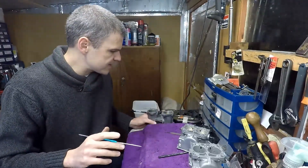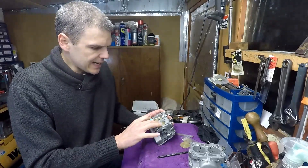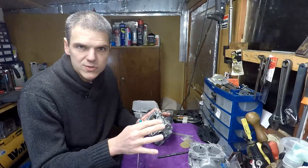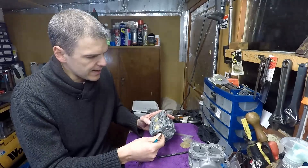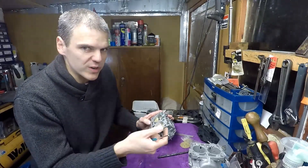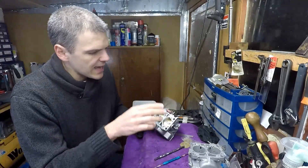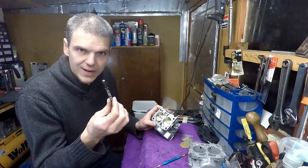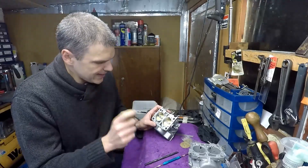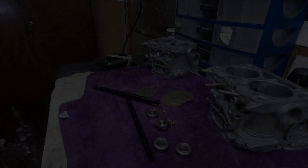For this particular build I'm going to do Phase One — just file it straight and use different throttle screws. It'll have a little bit more flow at the top end, the most you can get out of a standard setup, but it will help performance a little. I'm not going to go Phase Two as that is a special order item. Now I need to finish this one, treat it the same as the others — a corrosion treatment called chemical blacking, which I'll show you in a minute.